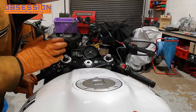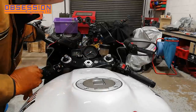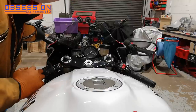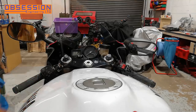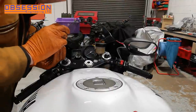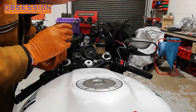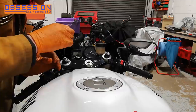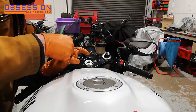What I'm going to do now is just put some really basic settings in — basically put the damping adjusters at halfway through their range and put maybe 10 turns of preload on just so that when I take it off the bench we'll have a sort of estimate as to where we're starting. The next thing I'm going to do is set the dampers into their mid position. So what I'm doing now is I'm going to wind the damper all the way until it stops. In effect what we're doing is we have a hole and we're pushing a bypass screw into it until it bottoms.